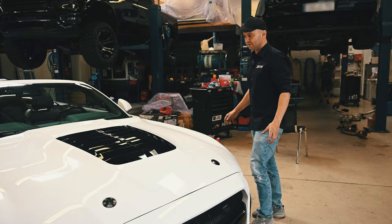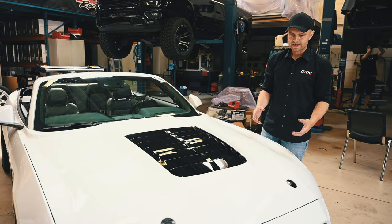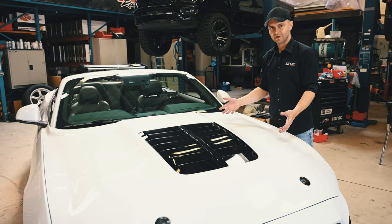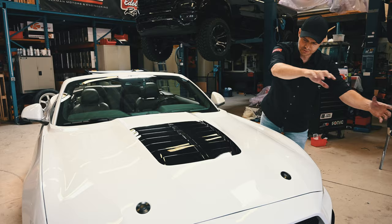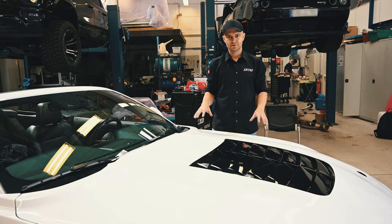When you imagine a closed hood with so many air intakes in the front and you're driving fast — where does the air exit? It exits on the bottom of the car and you're driving like a hovercraft on compressed air, with no downforce — you actually have some kind of upforce. This hood with its large air outlet results in very good handling because the air enters the front, exits on top of the hood, flows over the car, and generates downforce.